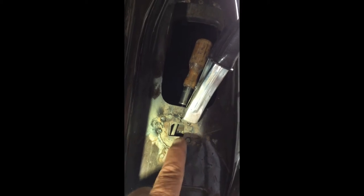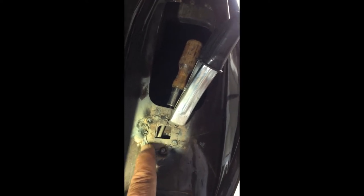What I'm having to do here - it's really thin metal around that clock face area. It'll probably have 12 spots on it by the time I get done. I started at the top because I got the best fit-up there first and was able to clamp it. I had to stick a screwdriver in there and kind of go around, keep pushing. I took a ball-peen hammer and tapped the outer area back towards the solid piece.